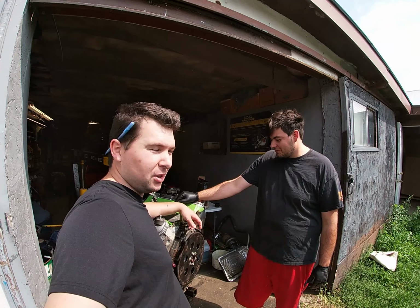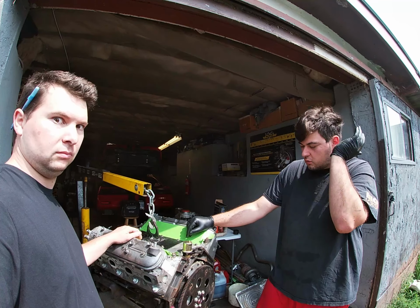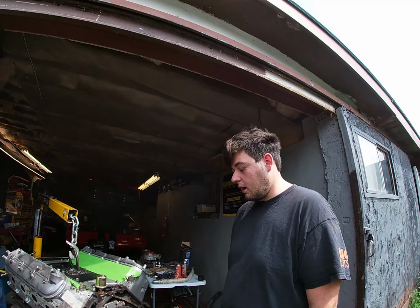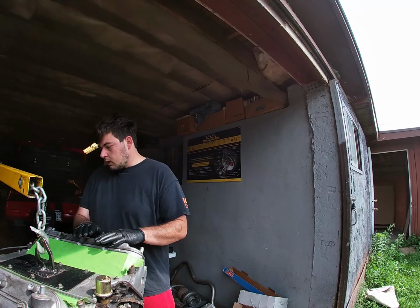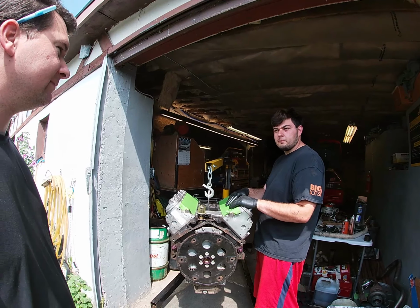That makes sense. Anyways, Brandon's got his motor together. Didn't film it much. I could look up the comp cam number for the cam, but it's a high lift, lower duration, like a 215, 223, 604, 610, 112, I think. It's a 6 liter with 243 heads, milled like 6 thou, just to get all the crap out of the cylinders. The motor this came off of was well maintained, to say the least, so we had to fix them up a bit. Lapped all the valves, moved my valve springs over. Basically it's a super stock Gen 3 6 liter with a bunch of squeeze that we're going to put a blower on. It'll be mint.